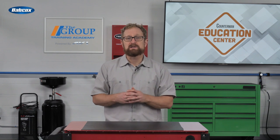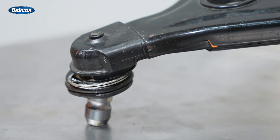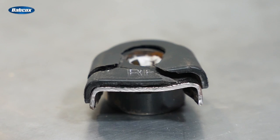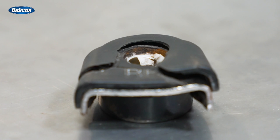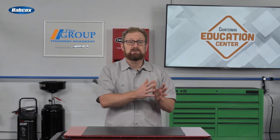Dorman Products has a different take on this issue. In almost all cases, joints make noise due to rust and pitting within the joint. Based on Dorman's analysis, water is most likely getting into the joints by way of these seams, and Dorman engineers have observed rust residue inside the ball joints that they've examined. In a number of previous Counterman Education Center videos, we've talked about how aftermarket suppliers will improve upon an OE design so your customers have a better, more reliable alternative to the OE part. And that's exactly what Dorman has done with the Tesla control arm.